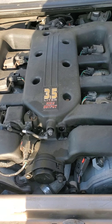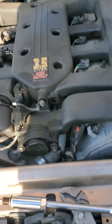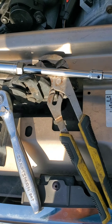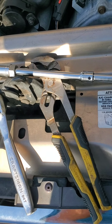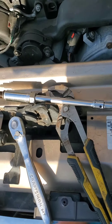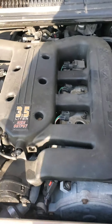You need a T25 to take the bolts out — little ones. And a spark plug wrench. They are pretty deep down in there, so you'll probably need either three 3-inch extensions or a 6-inch one and a 3-inch one like I have here. That way you can get your wrench up off of the intake manifold.